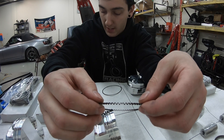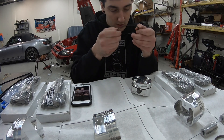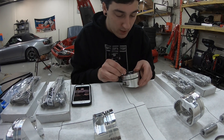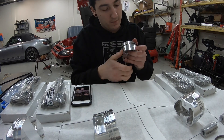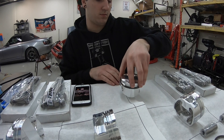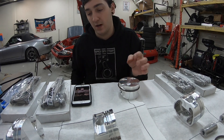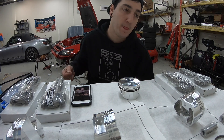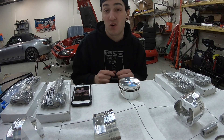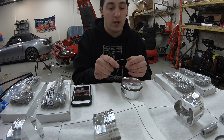You just want to butt them against each other like that. Now the writing goes up, but the second ring has a groove on the bottom to scrape the oil back down, so just by looking at it you can know which way is the top and which way is the bottom, but it does have writing. For the ring gap, your pistons will come with a booklet telling you what to get the rings to. A lot of people will get them to like 20 on the bottom ring and 18 or 19 on the top. The bottoms I didn't even have to gap because they were already at 22.